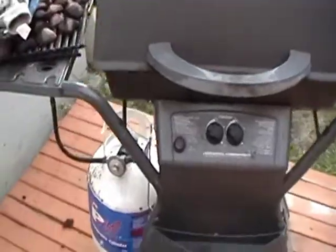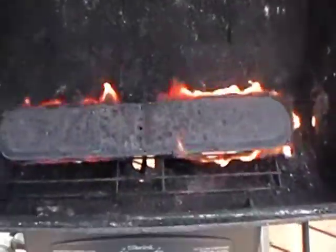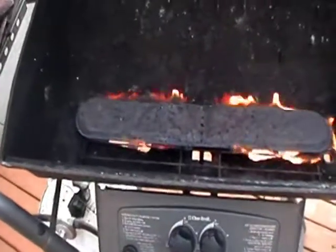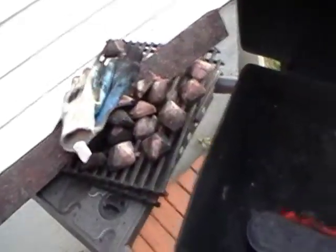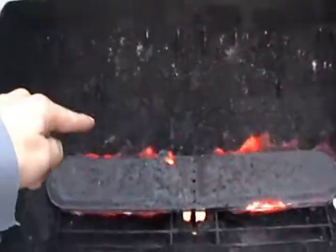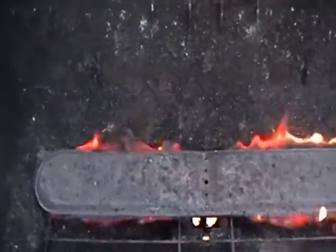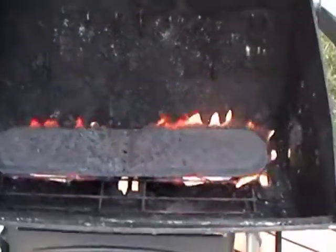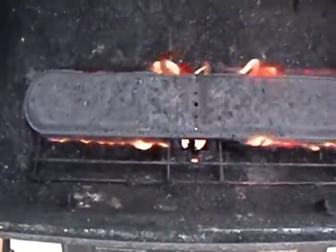So I hooked up the gas, started it going, and it caught fire down by the tubes. I cleaned it all out. There are the briquettes — I'm going to use some of my old ones. The other problem is it's kind of cracked back on this side, so the gas doesn't come out evenly and you can only have it on low. That's all there is to the barbecue, and then that little rack where the briquettes go.